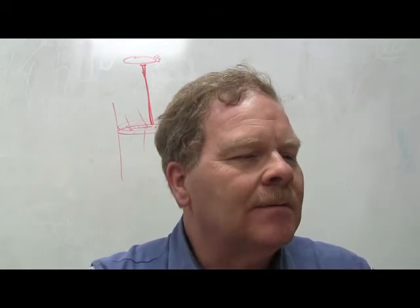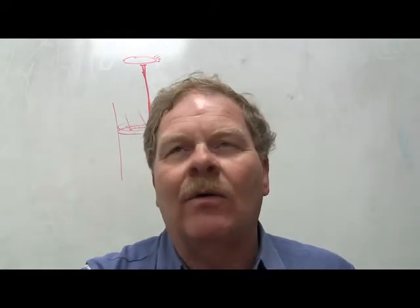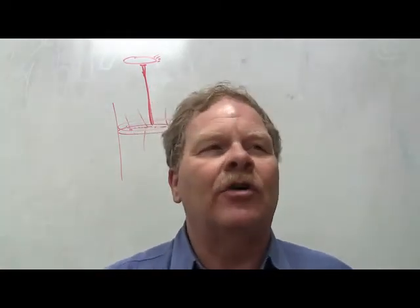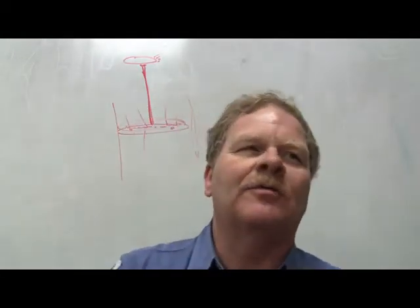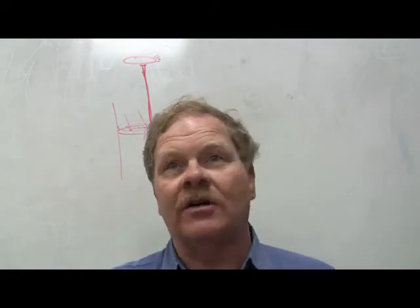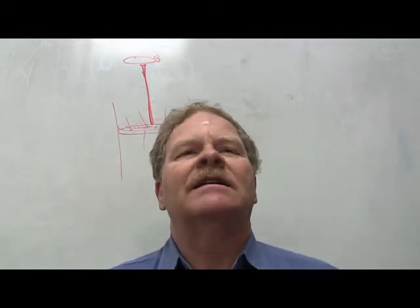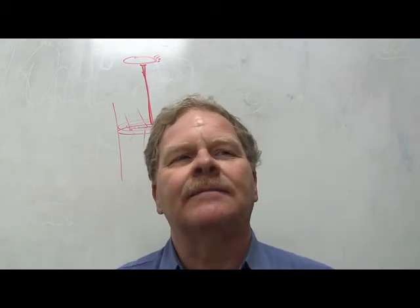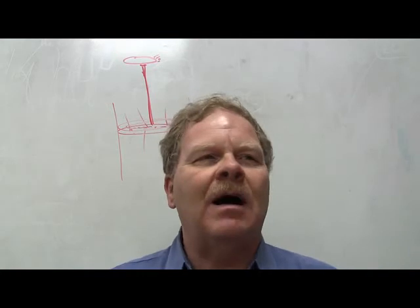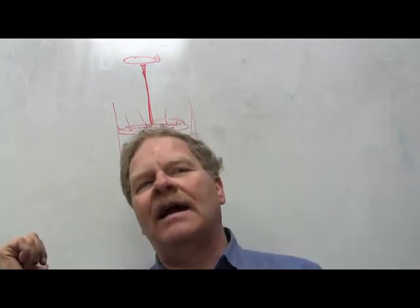Low air? Yeah. Well, what I would look for there is if you turn off the air suspension switch, like you were wanting to do on that car this morning. If you flip it off so you can raise it up, you're going to see that air suspension come on. Another time when it'll come on is if it's trying to correct a ride height situation and it can't do it. If that module tells that compressor to come on, it's going to be looking at the ride height sensor.